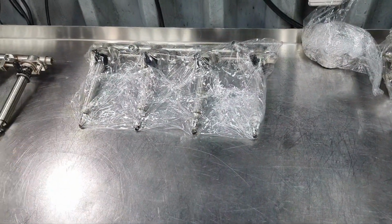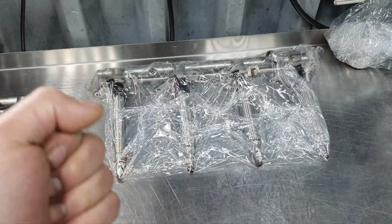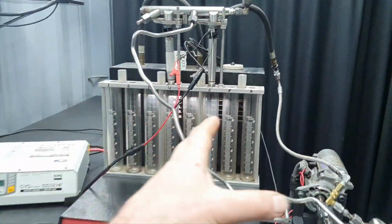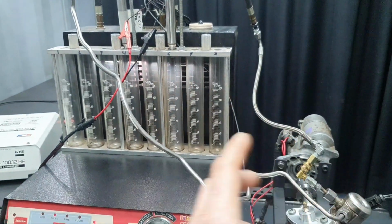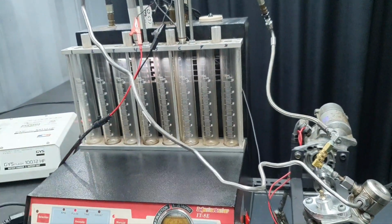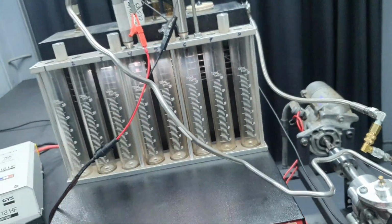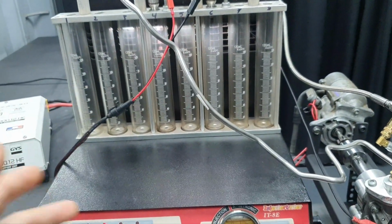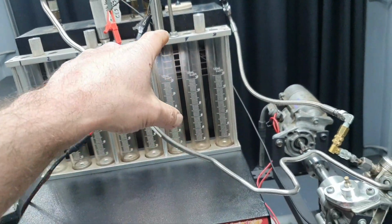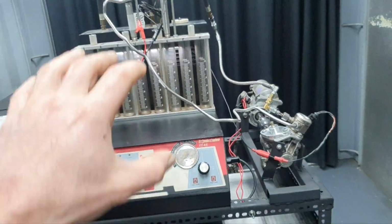It might be even leaner, so you're going to create an explosion inside. You're going to increase the temperatures much more. I have mentioned that before, and that's what I'm talking about. And it's not only direct injection; even with low pressure injectors, you can see the same things. If you melt a piston and then you get the old injectors and compare them, you're going to see that one injector on the specific cylinder, if it is an injector failure and not from the software, the tune or whatever, is not going to perform the same as the other ones. It's going to be more down, more reduced.